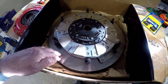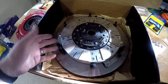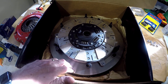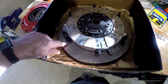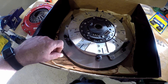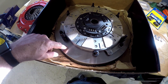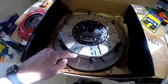They don't know what condition the flywheel is in. If it's been sitting on a dealer shelf, maybe sitting on its end — that isn't good for things like this; it can actually cause warpage. So they want you to touch it off and put a texture on it between 80 and 100 grit, which I think is a little rough, so I'm not going to go that aggressive with it.